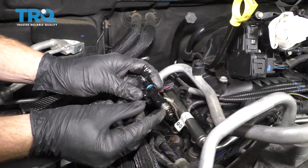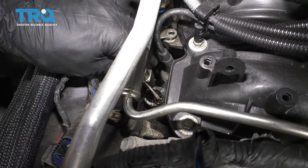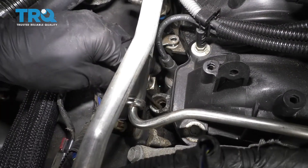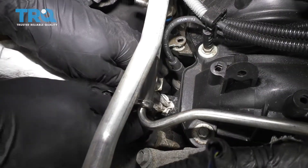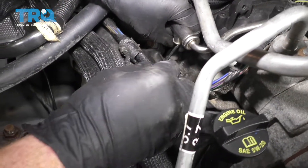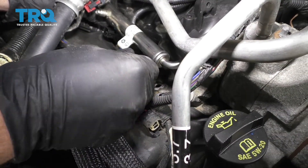Looks like our gasket that's supposed to be right here is still inside the engine, so we want to make sure we get that out of there. I've got my flathead screwdriver — just pull that right up and out of there. We'll recycle that. Now we want to make sure we clean up this hole, just trying to get the crud out. We want a nice smooth area for that gasket to ride on. I'm going to check to see if there's a gasket up in here — just feel around with my pick. I'll double check with my mirror. There it goes — there was one. Grab it real quick.